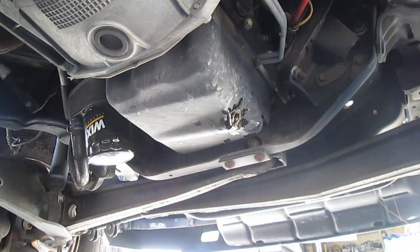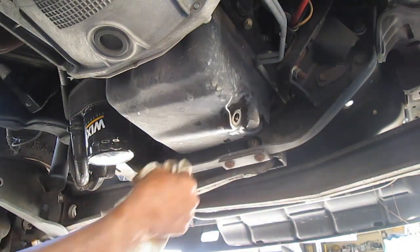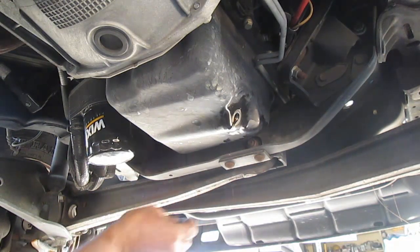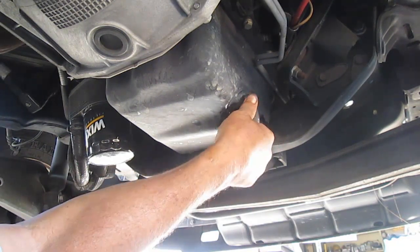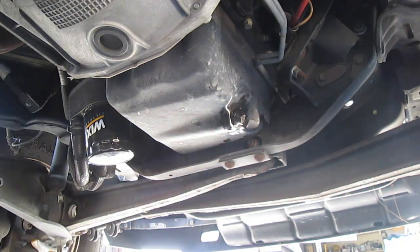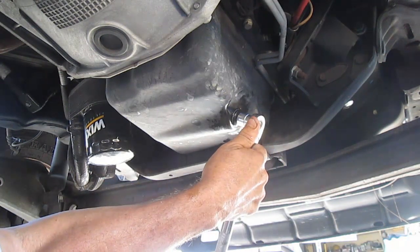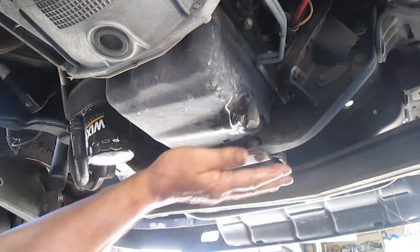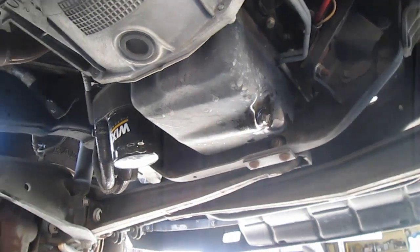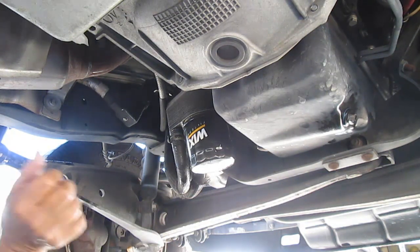You can see we're almost done here. Wipe that off, get the drain plug, put that in there. Always start these by hand — if you cross the threads, I feel sorry for you. You don't have to over-tighten it, it's not going anywhere. And there it is. So on the bottom: drain the oil, put the plug back in, and over here we put a new oil filter. That's all there is to do on the bottom. Now let's lower the truck down.